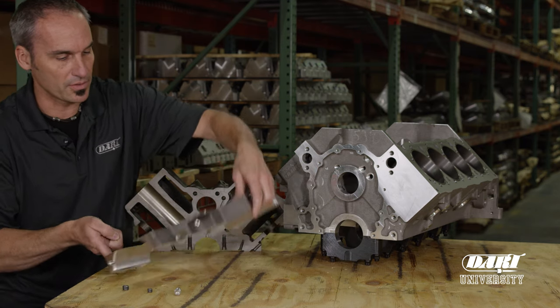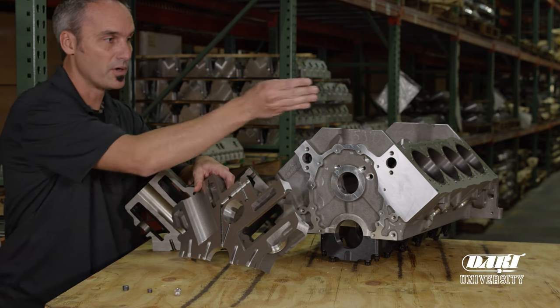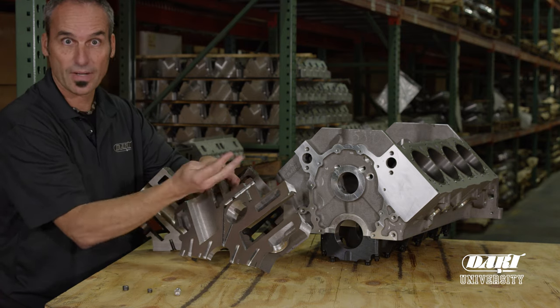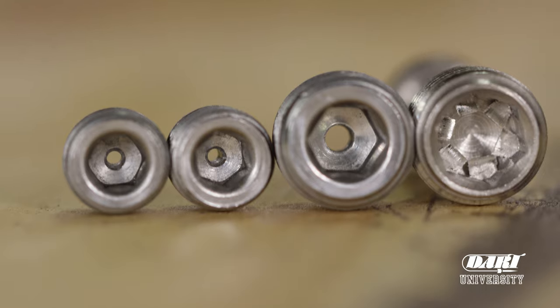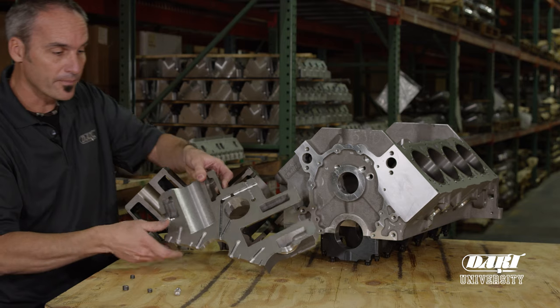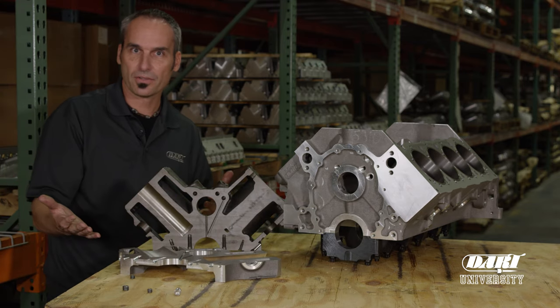So for instance, in this case, you're feeding your mains and there's a crossover somewhere — whether it's the front, rear, or in the middle — that's going to provide oil to your valve train. You can add a restrictor with a small orifice in it and block that off, controlling the oil upstairs as well for that ultimate balancing of the system.